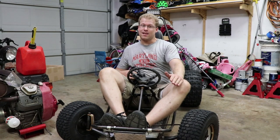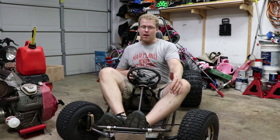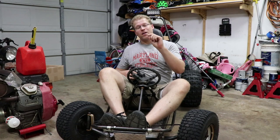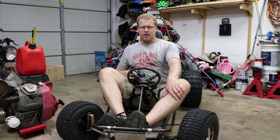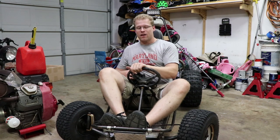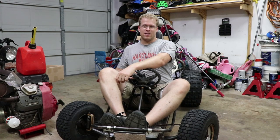That's pretty much the max torque I'm going to be able to pull out of this without doing some serious work, like milling the head or boring it out to a bigger bore, or messing with the flywheel inertia. I'm just going to try and get a smaller head gasket to get a tiny bit more torque, do a little bit of porting, put the battery in there, and get it all going so I can finalize this and move on to my next project. Thanks for watching and we'll catch you in the next one.